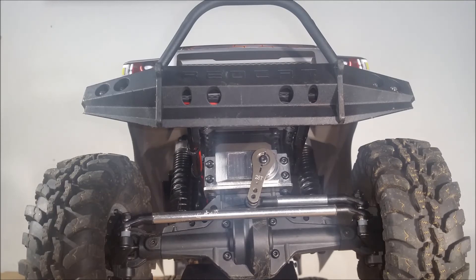One thing you'll notice is that we did not install a BEC. I'm running this servo directly off of the stock RedCat speed control, and in doing so I haven't had any brownouts — I'm pretty happy with how it's working so far. In the future, I may try to experiment with some low-cost BECs, not only to see how those perform, but to see how this servo can do with higher voltage. When I do that, I'll come back and add a link to this video. But in the meantime, I'm just going to go ahead and use the vehicle — I'm quite happy with how it works.